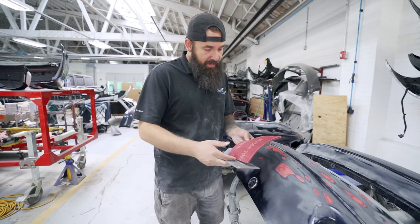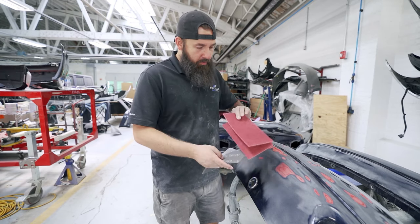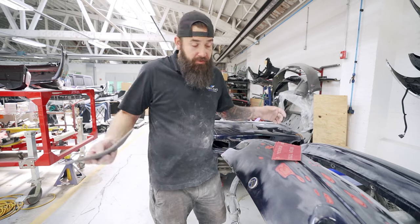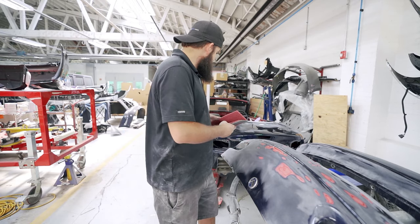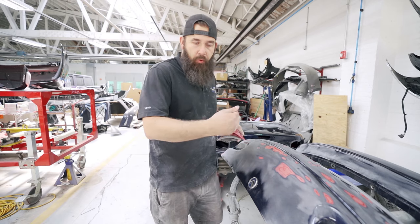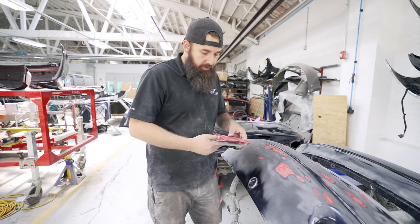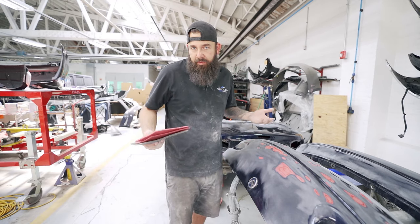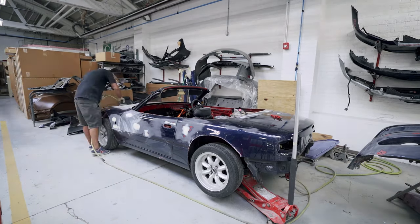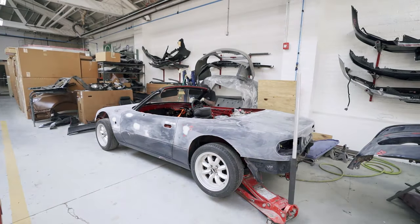It's time to scuff. I've got these Mirka scuffing pads — 360 grit. The red is a little coarser and the gray is a little finer. They gave me both to scuff up the whole car. We still have that big dent to fix in the rocker panel — Dave's going to help me pull it out using some rivet-type things. Then we'll do some shaping with glaze and sand it all out. I actually started hand scuffing and a technician quickly came over and let me know I could just use the DA with 800 grit sandpaper for all the big panels. That would have been a big job.